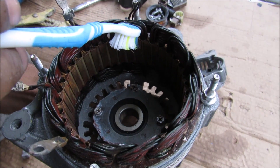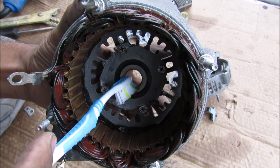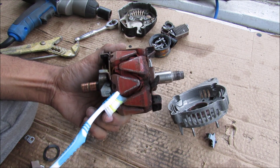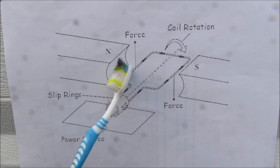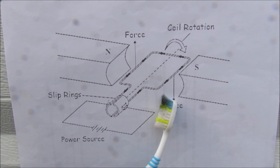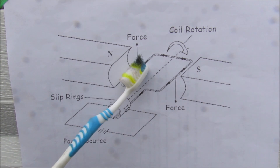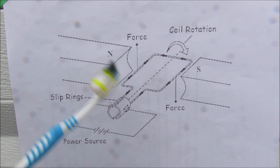Here's a closer look inside of the stator. You can see that all the coils are wrapped around these iron cores, which helps create electrical energy from the electromagnet that's spinning around. On the inside here we have another bearing for the rotor. The rotor is basically the core of the alternator — it consists of a shaft that has two bearings on either side so it spins smoothly, fan blades on both sides to help with airflow, and coil windings that wrap around an iron core. We remember from basic mechanics that if you've got a coil with power running through it in the presence of a north and south pole, it will experience a force causing the coil to rotate. The reverse of this is exactly how the alternator works — the north and south poles are replaced by a magnet rotating in the middle, and the coils are placed stationary on the outside in the stator. When the electromagnet in the middle rotates it generates energy in the coils, which charges the battery.